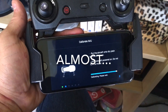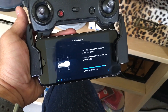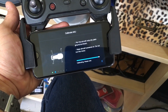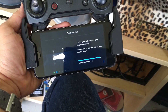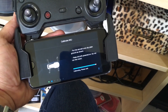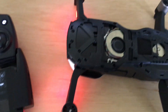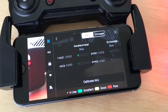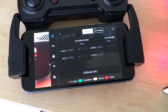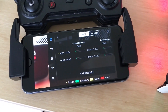After it was on for a little while, it said it needs an IMU calibration, which is awesome. I put it on flat ground, kept it powered on, did not run the motors, then clicked the calibrate IMU button and it popped straight up with Start — and this time it did start calibrating. IMU calibration is done. It went through the steps: switching it around, on its side, on its back, etc. The instructions weren't totally clear — I waited about five minutes, then realized you've got to follow the orientation on the screen. Put it on its side, back, front, and off it went. Now accelerometer, gyroscope — everything looks good.